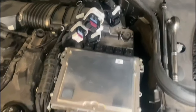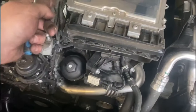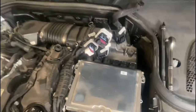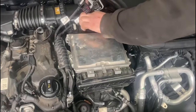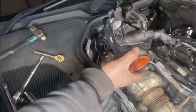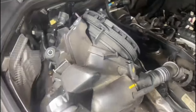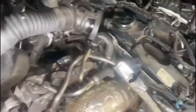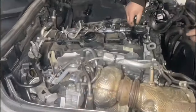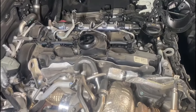Now as you can see, we've taken out the wiring harness for the ECU that's on the air filter box, removed the Torx 30 bolt there, and we're going to separate the wiring harness from the air filter box and from the intake system. We've also taken off the intake pipe that goes into the turbo — it's got a Torx bolt — along with the DPF pressure sensor, a breather pipe and the sensors along it. Now we've took off the wiring loom covering going around the rocker cover and we're slowly going to remove the injectors and get access to the rocker cover.